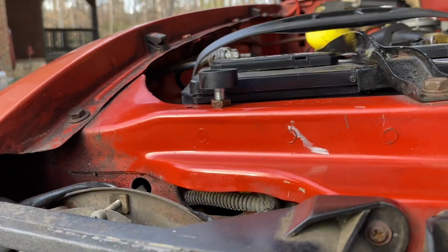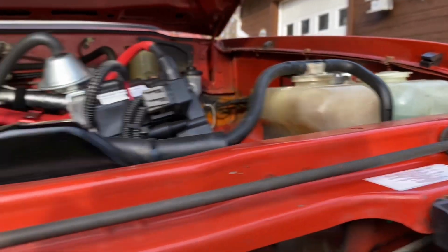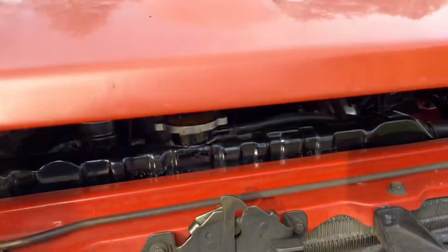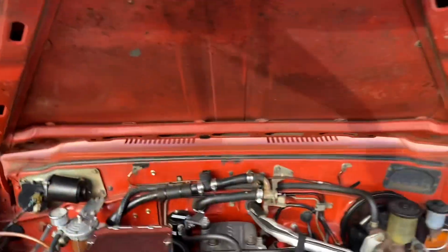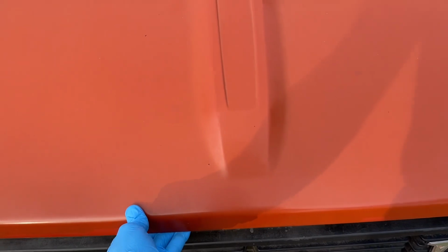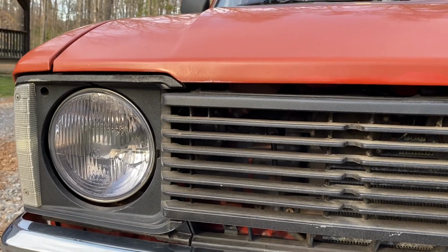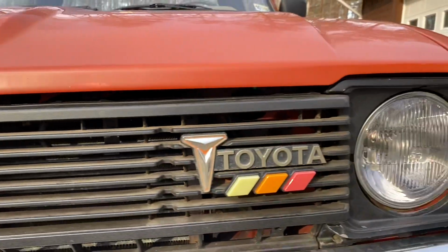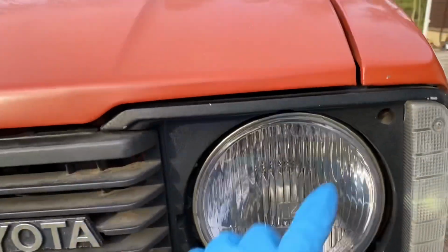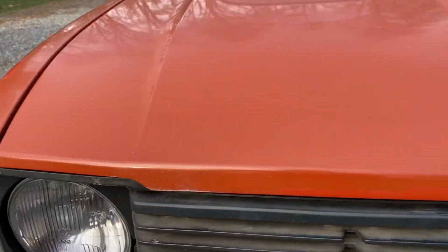So coming in here and looking at these, I think I got it close to the height of where they ought to be. And what it's gonna come down to is closing the hood on it. So I'm not gonna slam it, but let's just set it down on there and shut it like that. Now, if you look, it could come up maybe a tad. It's pretty well lined up right there. And it's shut right now.